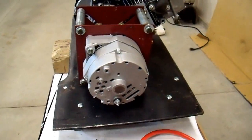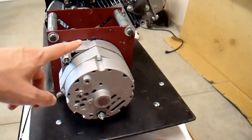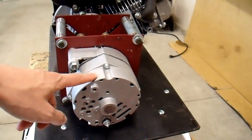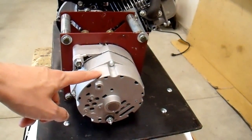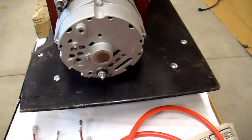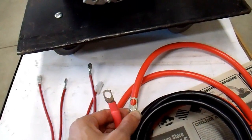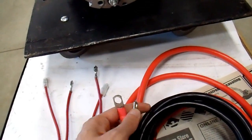It's important to note that an alternator like this — you cannot disconnect from a battery while it's running, or you very well may destroy your alternator. So it needs to be permanently tied. For that reason I'm not using alligator clamps; I'm using ring terminals like this. That way I can be sure to hook it up, start it up, and they won't come loose during operation.